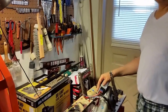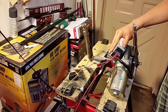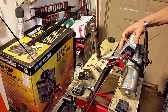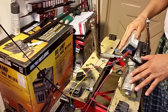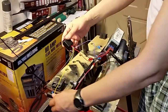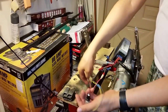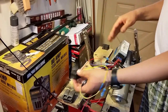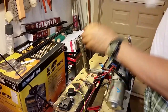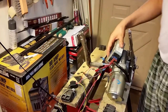I'm replacing the hydraulic power steering pump from a Toyota MR2 with electric power steering that attaches at the steering column. This is from a Saturn Vue 2006. The way to do this is to get one of these — either from eBay or the junkyard — and then get one of these controllers that you can buy at epowersteering.com. You can either buy the full model there with a few other components, or just buy the controller. In my case, it's much cheaper to just buy the controller and install it. It comes with nice instructions on how to wire this, and it's compatible with several models of electric power steering units for standard cars.